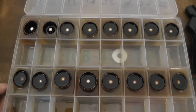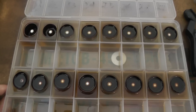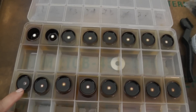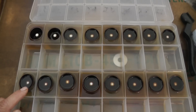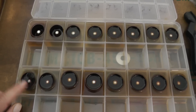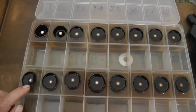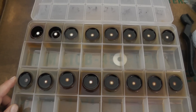What I want to show you right now is I'm cleaning up the lifters. When I took them out I put them in engine oil and set them aside — the biggest thing was just not wanting them to rust. Now I've got them in some carb cleaner and they've been sitting in there for a couple of days. You don't have to do this, but I was a little concerned about sludge being up inside here that would cause the lifter to stick and result in valve ticking.